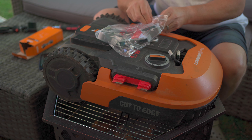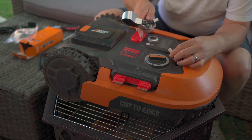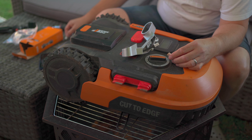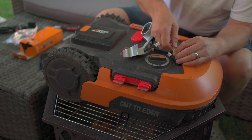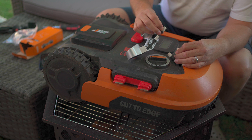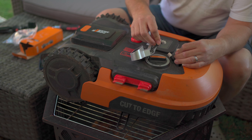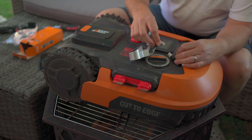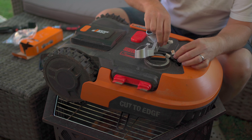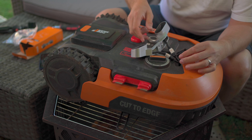It's already pre-wired for it. On the pre-wiring you have a couple of dummy plugs — just push the top in and slide them out. Now if you look on here, you've got two different plugs: one that's a bank of six in a squarer shape, and on the other one you've got more of a rectangular shape with like four pins. So it just pushes in like this — listen for the click. That's clicked in place.